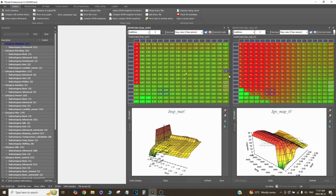This whole system works with the turbo sizing and the manifolds and everything, the injector sizing, the fuel pressure regulator, all that. It relies on all of those working together basically to make this map function, which makes this tune very specific. So these numbers do follow VE on high boost, but on lower boost, which is second gear, the numbers are pretty basic. It's actually quite rich on lower boost.